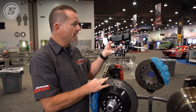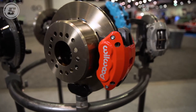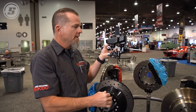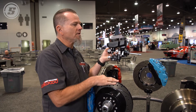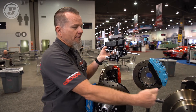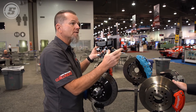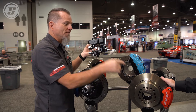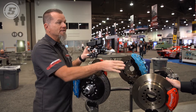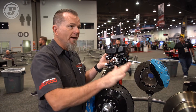When the master cylinder is mounted on the firewall but the rear is a drum brake, it is a necessity and imperative that you run a 10-pound residual valve to the rear drum brakes. Why? Because the drums have two shoes and a spring that goes over the wheel cylinder. That wheel cylinder has springs that will compress and force the fluid back into the master cylinder. Having 10 pounds of residual pressure prevents that from happening, keeping everything nice and taut so that when you depress the brake pedal again, you have a nice, firm pedal.